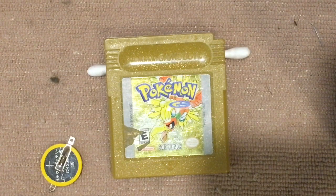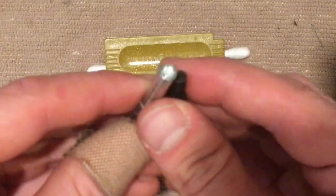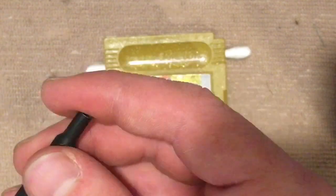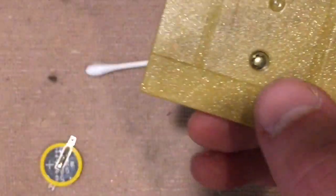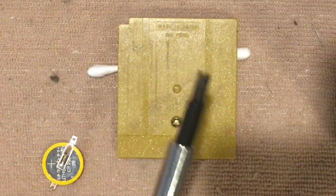In order to do that, you need a couple of tools. First thing you need is a screwdriver. And with that screwdriver, you need a game bit. This one is used to open up Nintendo cartridges — it's the smaller of the two. They also make a larger one which is used to open up the consoles themselves. These are fairly cheap; you can buy them on eBay for a couple of dollars each. It really is a huge time saver because the screw itself is a very specific screw, so you're not going to be able to get that out with any type of standard screwdriver. There are ways to get it out without doing that, such as melting a pen and molding it around the metal, but this is just so much easier.